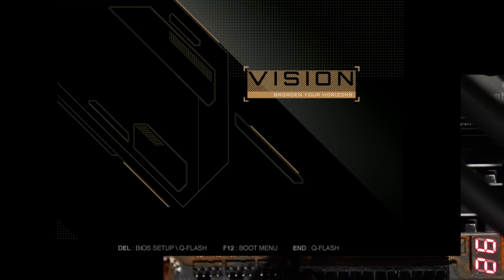Not worth fighting with it. And we'll take a look at how Cinebench behaves, and then I'll show you how the boost algorithm just decides to turn itself off if you push the BCLK too high, which is by far the most annoying thing that I've run into, because it basically means even my BCLK overclocks where you aren't forced to go down to PCIe Gen 2 and stuff. Yeah, those are still not viable.